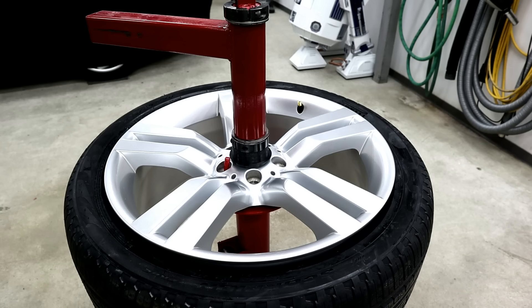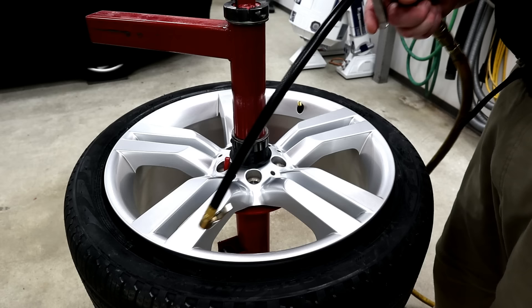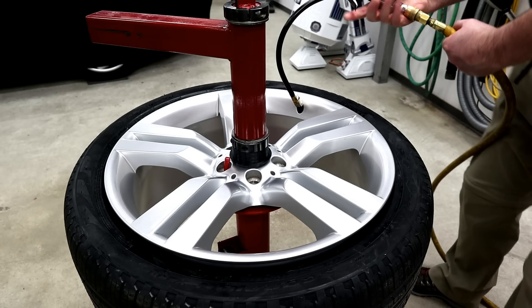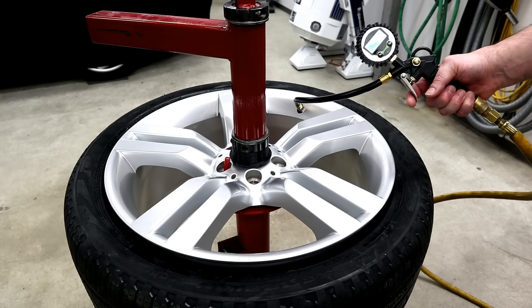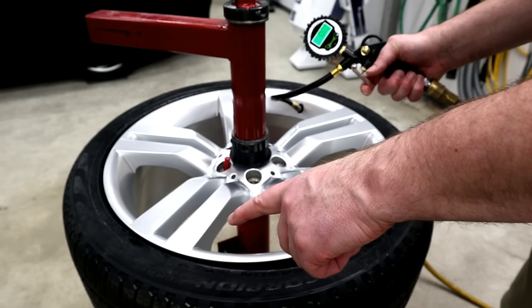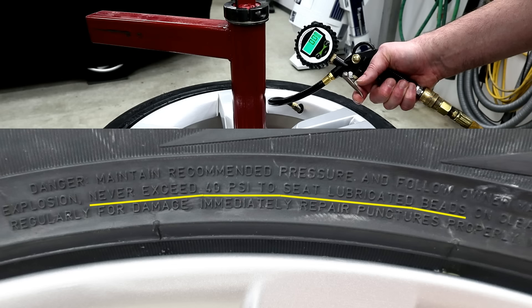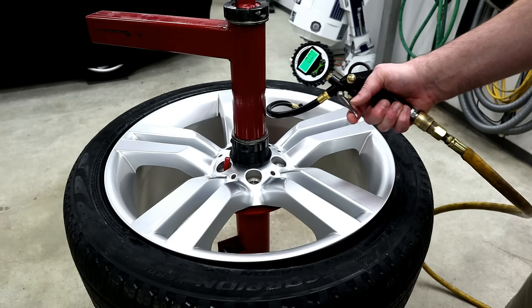Now we get to do the most fun — and dangerous — thing: seating the beads. Get your eye protectors out. You're probably going to need an air compressor for this because you have to force a bit of air in there pretty quickly. I like using these digital gauges. Tires will have a maximum bead seating pressure — usually around 40 PSI. Double check: these are 40, so you don't want to go over 40. As long as you've got lubrication on there you shouldn't even come close to that. Back bead usually seats first — you'll hear it pop.